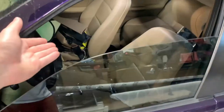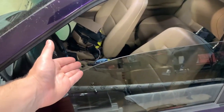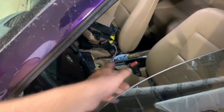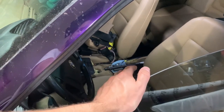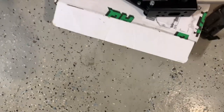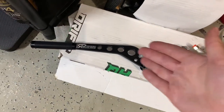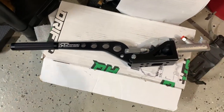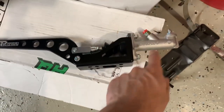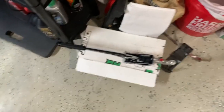This is my second attempt at installing a hydraulic handbrake in this car. Part one I had the Swaggier inline hydro using the stock handle — I couldn't get it to work quite well. So I ordered another handbrake: the IRP hydraulic handbrake, a pull-up style, with the Wilwood master cylinder, 0.625, on there.